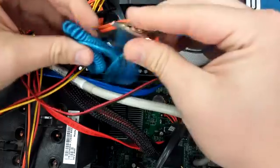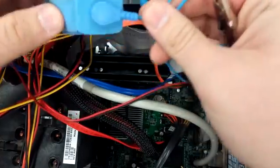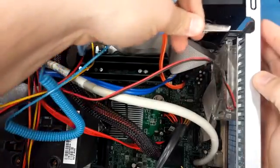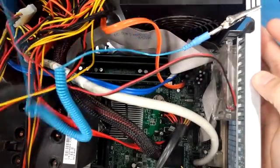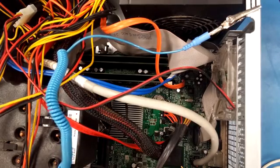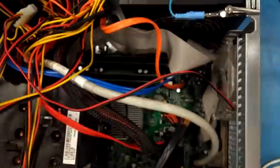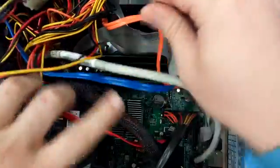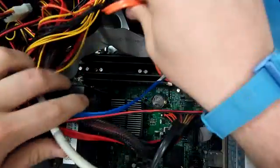Make sure you do not forget your ESD wristband — that is an electrostatic discharge wristband. You attach the metal clip to a metal brim of the case, then put the wristband around your wrist making sure the center is touching your skin. This will ground you to the computer, preventing you from statically charging something and breaking the inside. Some of the major components are sensitive to static discharge.